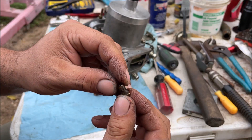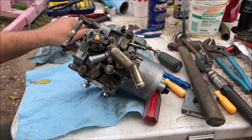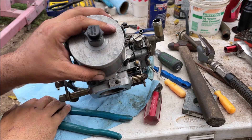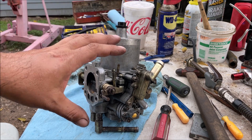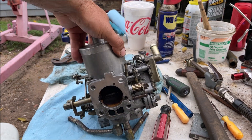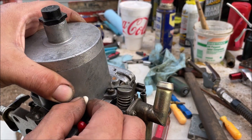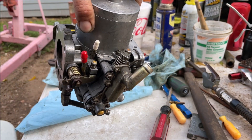We have a fuel filter - it's actually damaged a little bit, but I'll put it in there anyway. I don't think this fitting goes anywhere. So I've never messed with one of these carburetors before, but you see what I just did: I took it apart, tried to understand as much as I can. From what I've seen so far, we can go ahead and remove this fitting since it doesn't go anywhere, and we can plug these two ports off for right now. Everything else is going to have to be hooked up. I use different colored plugs so I can notice them - I only use the black ones when I'm 100 percent sure they can be blocked off.